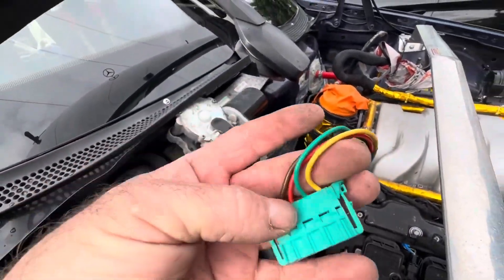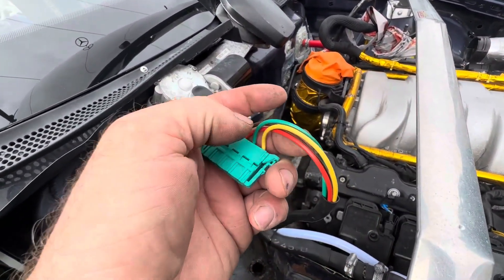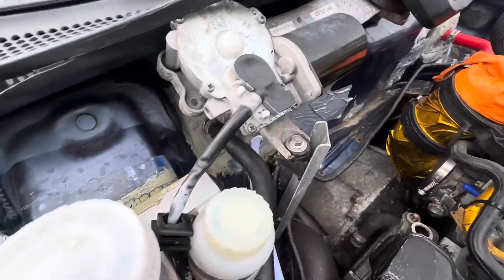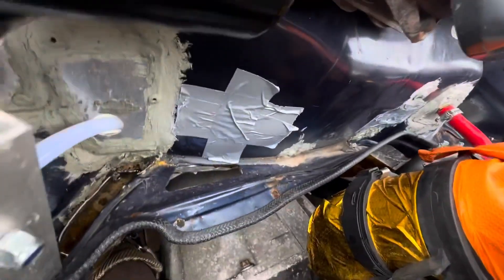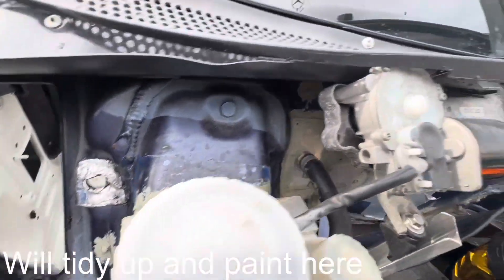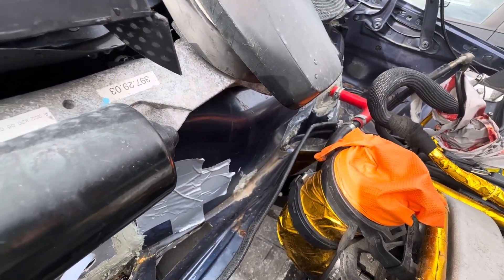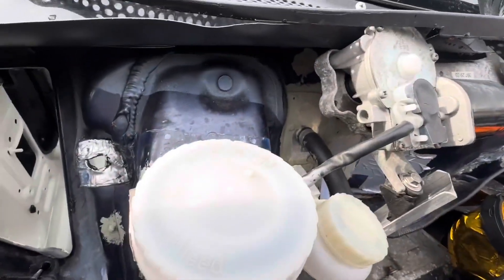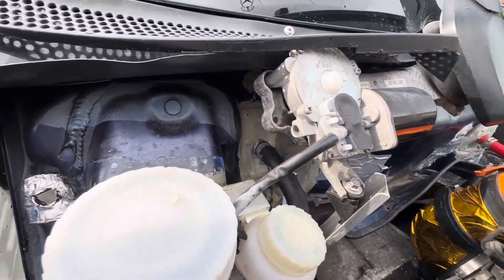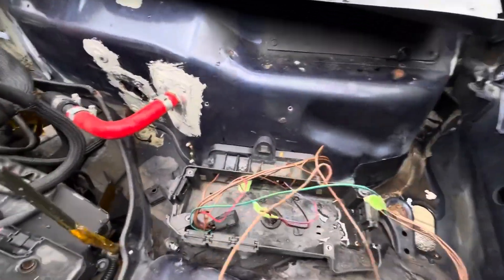Next we need to figure out the wiper. This is the wiper motor feed — one wire is full speed, half speed, signal for park, and an earth. This will go through the same bulkhead connector I've made for the PDM. Once I've got the bulkhead cleaned up, I'm going to paint it all nice, seal off any holes I've drilled previously, then paint it and go over it with some heat-reflective gold stuff.